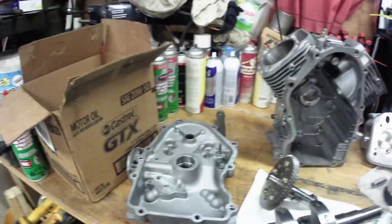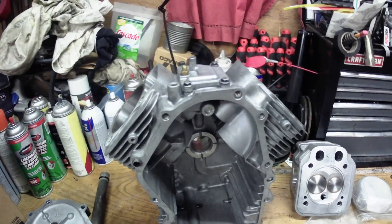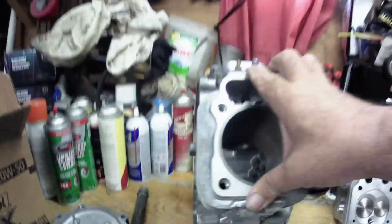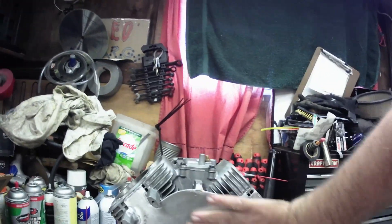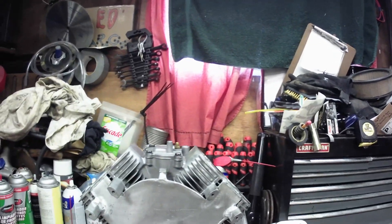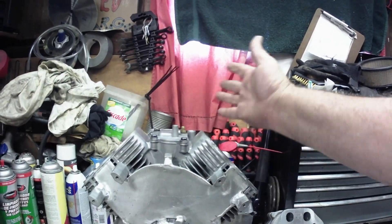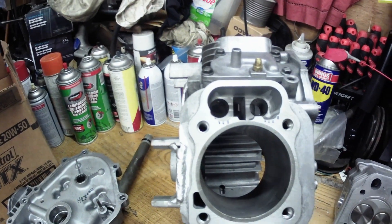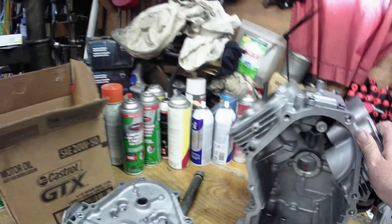It's a V-twin 15 and a half cubic inch, so let's take a look at it. I got the parts laid out — there's the closure plate, we got the block up here. It's all been bored and sleeved and ready to go. It's been reinforced, welded up here on the sides to keep the jugs on. It's got the plate on the front here to keep it from stretching and cracking, goes clear up into the heads.